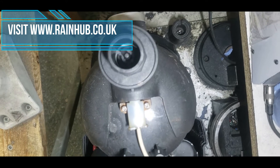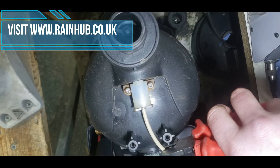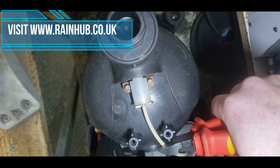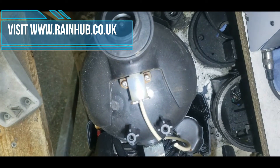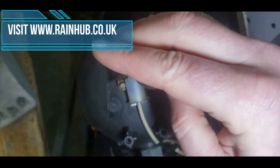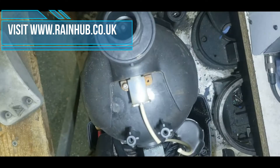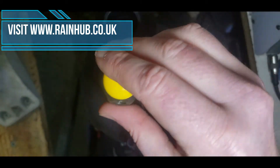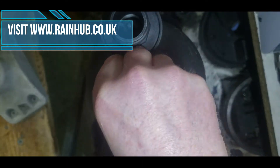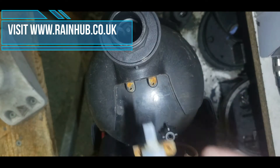I'm going to cut the wire, leaving around five to ten centimetres on there. Then, using a Phillips head screwdriver, undo the two screws that hold it on. The old hall effect should just come out.